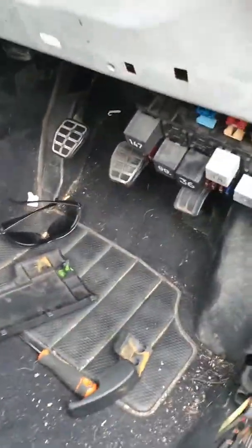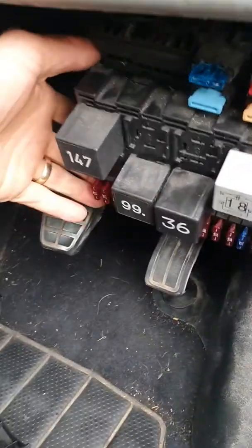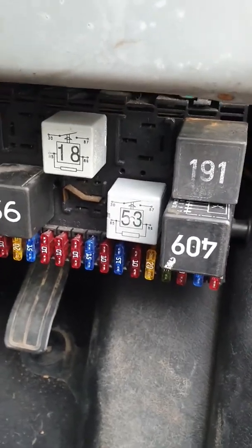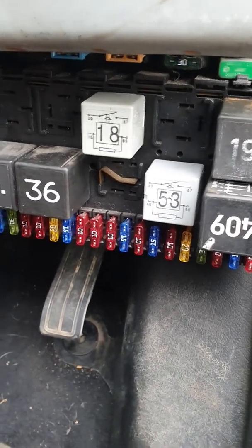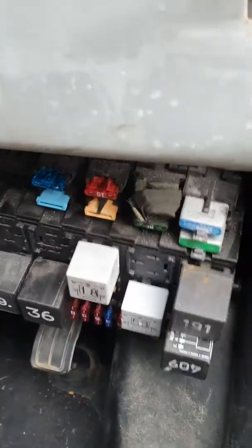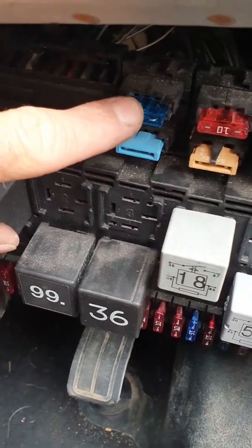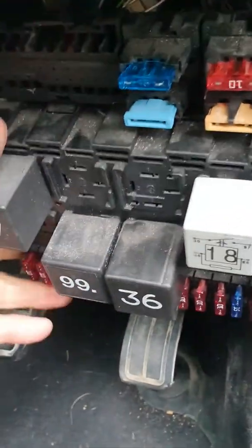It's really difficult to diagnose because every time I looked online every single fuse panel was different from the one I had. Relay 409 is your fuel relay - you need multiple inputs into that to make it go, and one of them is an ECU input, so you have your crash sensor and your ECU input. I traced the black wires back into the box and found a 15 amp 32 volt slow-blow fuse.